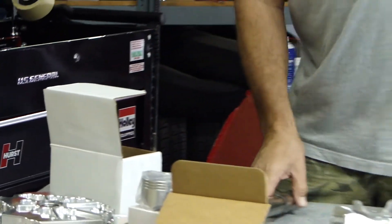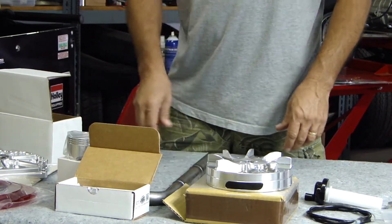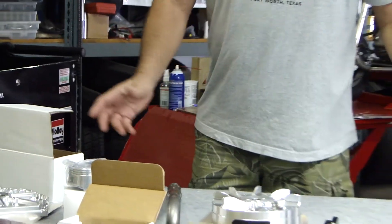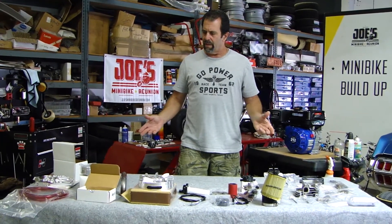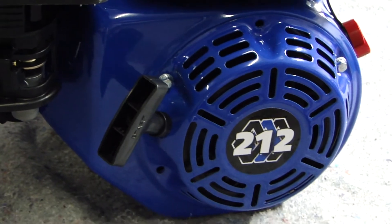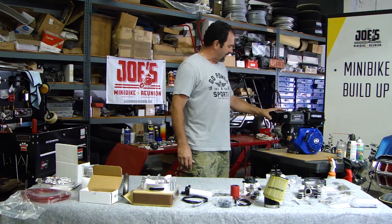Finally, to finish it all off, we have a three stage FMB pipe — low center exit, so that'll be exiting out the back to handle the exhaust. We're also running a brand new flat top piston complete with a new set of rings. So as you can see we've got a lot of parts here, a good amount of work to do. The performance gain should be quite healthy and I'm looking forward to getting it done. Converting them from the Hemi to the non-Hemi — I'm looking forward to getting that done.